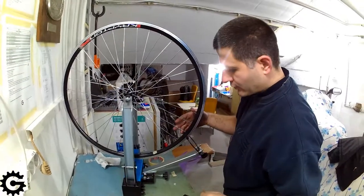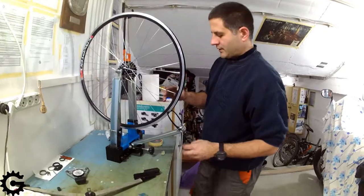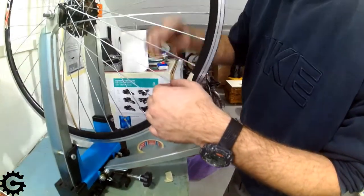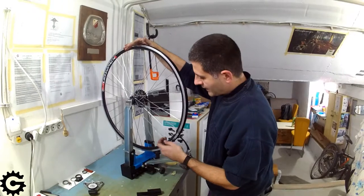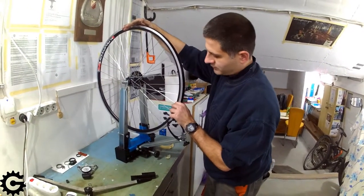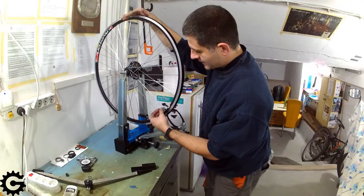That makes sure the spokes are stress relieved at the elbows and that they are nicely seated, bedded in. After all these checks are done, now we can check for what I would call true spoke tension, because now the spokes are aligned, and any badly seated spokes will now bed in nicely and probably lose a bit of tension. That would probably have happened during riding, but it's better to check it on the table before.